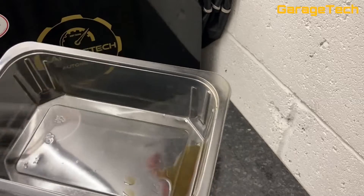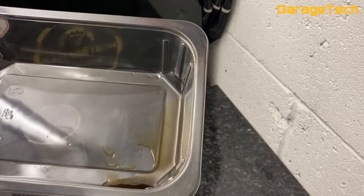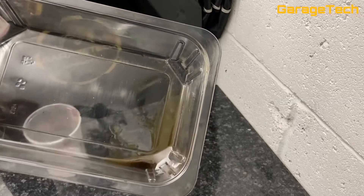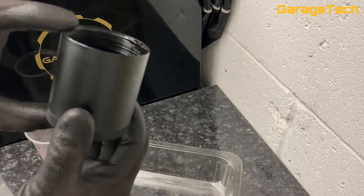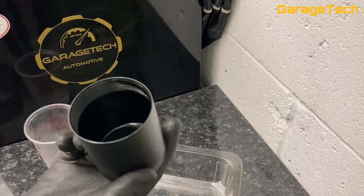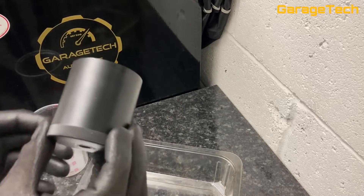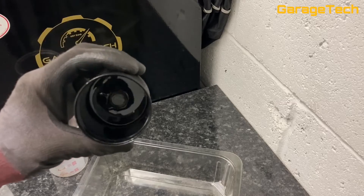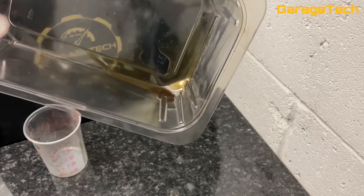What I can tell though is that there is still some of the gases getting through — and there's always going to be gases getting through — but there's obviously still some oil particles within those gases getting back through into the intake manifold. So I might take a look at some other catch tanks and compare those. I'll have a look to see what else I can find out there on the market. This was probably one of the cheaper ones — it's only got a small tank on it. Perhaps something with a better filtration system on it might actually reduce some of the oil particles getting back into the intake manifold. And if I put another one on there, I'll post it up and let you guys know, just so you can see how much oil has been saved from going back into the intake system after about a thousand miles.